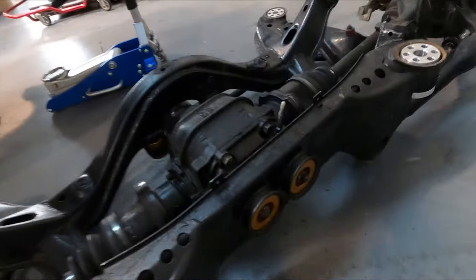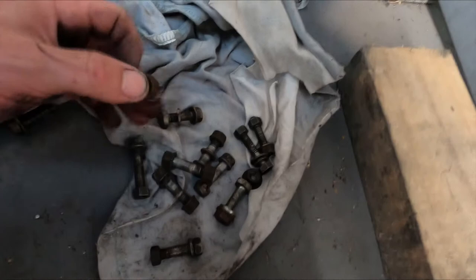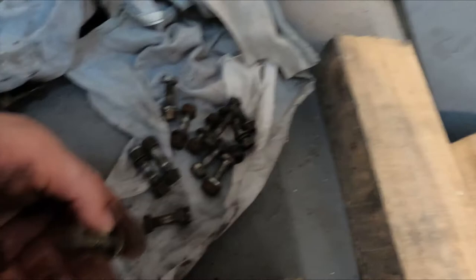So, after our flywheel and clutch debacle this evening, we have achieved something. We've installed our solid mount subframe bushes, diff bushes. I'm going to go down the road and get some new high tensile bolts for these, because I've got a whole lot of random nuts and bolts, all different sizes, that someone's put in there before. So I'm going to get all new high tensile bolts of one size for the axles to the diff, and then I can slap this back into the chassis,